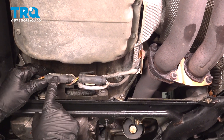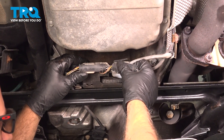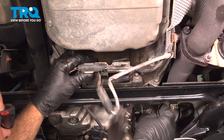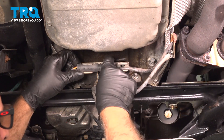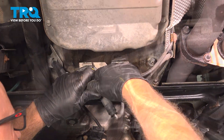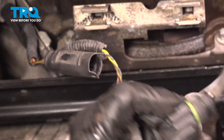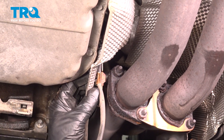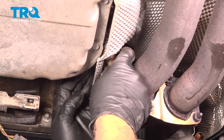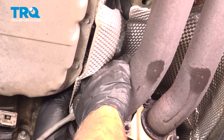For the one through three cylinders, we're going with this connector. Either way, we gotta pull this one out of the way — pull it out of the bracket. Then we can grab this connector, disconnect it, just gonna use some pliers, slide that out, follow the wire back. There's some retainers — slide it out of the retainers and push that up.